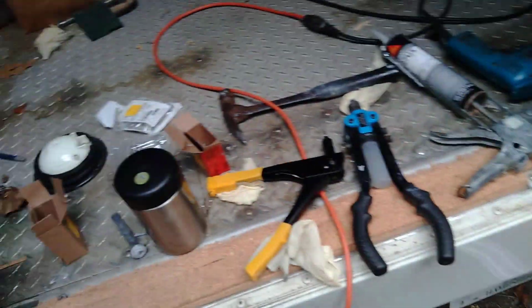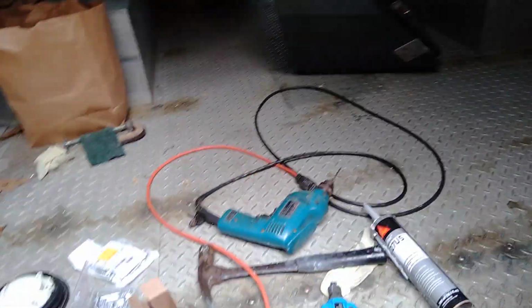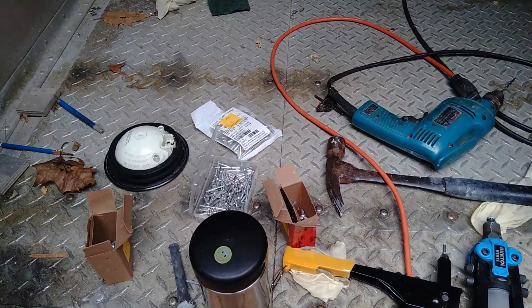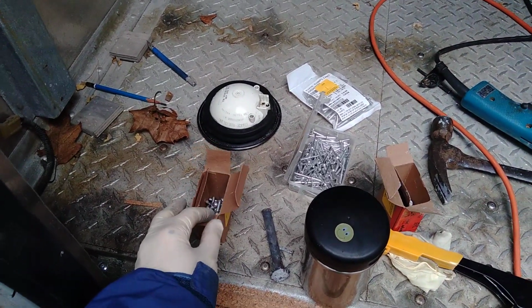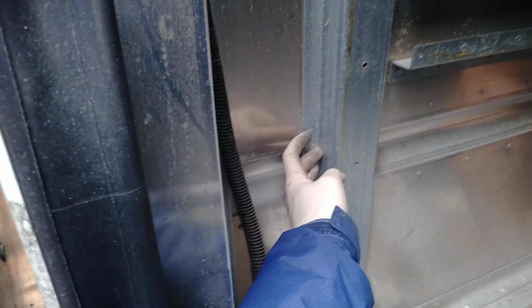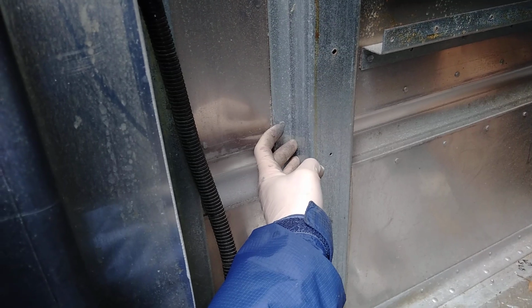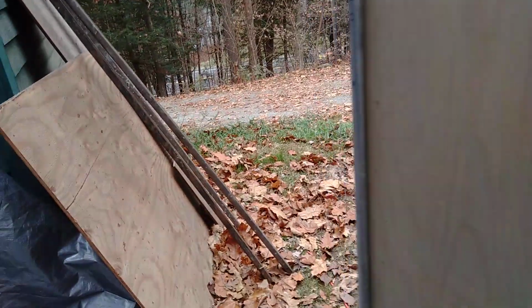But anyways, these are some tools that I use. Screws. The other thing with a rivet too, you have to drill a hole before you can put the rivet in. And of course they take way more time. A screw is definitely faster, but a rivet's I think stronger than a screw because it's hooked by both sides. A nail or a screw just penetrates and grabs onto the material.